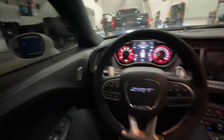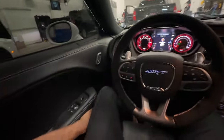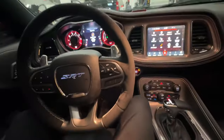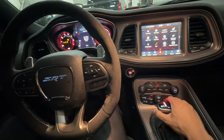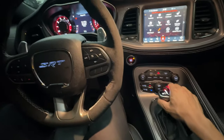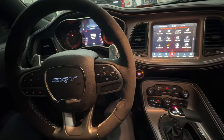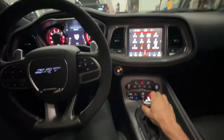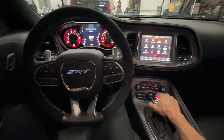We hit unlock, open and close the door to simulate coming into the car. Now if I don't authenticate the car and I put my foot on the foot brake and try to come out of gear, the vehicle will not shift out of gear. Even if I push the push-start button and try to move out of gear, it just will not — I need to authenticate the car to allow me to shift out of park.